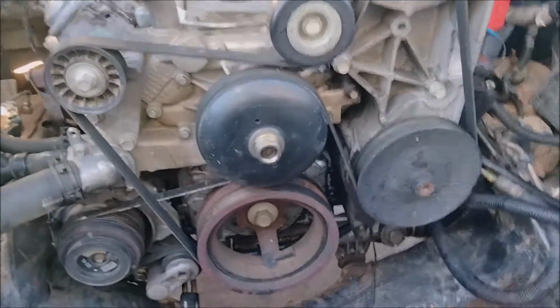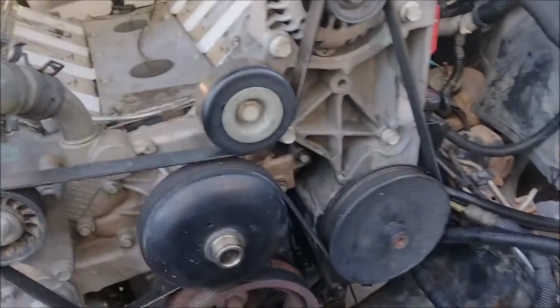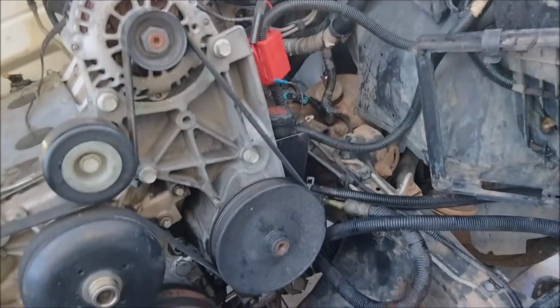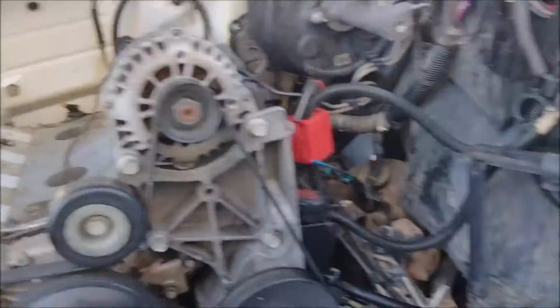AC pressure switch. On some of the compressors there'll be a pressure switch on the back of the compressor, and some won't. It just depends on the wiring. If you have a compressor without it, and you don't care that it's not hooked up, since you have that pressure switch and this pressure switch, then you can just bypass it if you want. Or you can get a switch. It's up to you. It all depends on how everything else is programmed, so I try to match that.